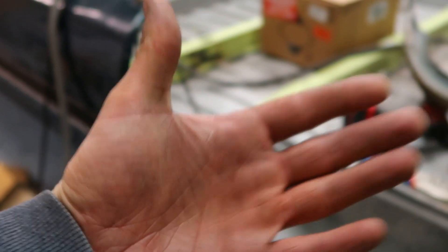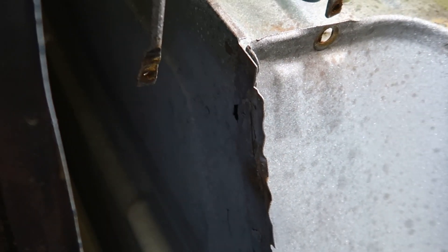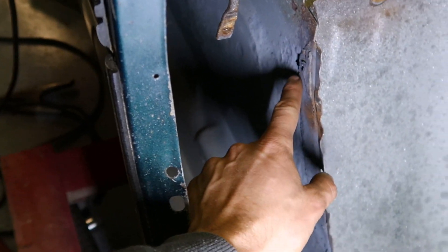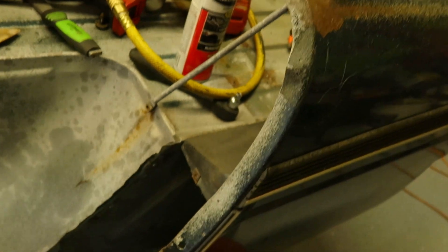There's still plenty of metal there. I'm going to try and get this coated as best I can before putting the new piece in so I don't want this rusting out in two years. I just took some 220 grit sandpaper and went over everything. Right up in here is the bulk of what was rusted. That's actually a small hole — but when I go to put the new panel in, it sits right over top of that hole. So I'm just going to do a little bit of fiberglass work, mold it, and be good to go. Everything else I coated nice and heavy with primer — it is a little runny, some runs in it, but that's fine.